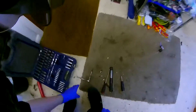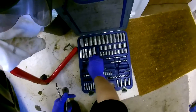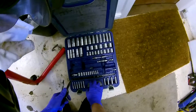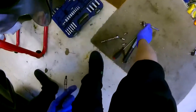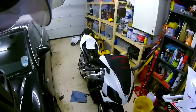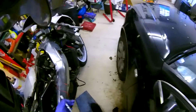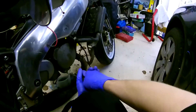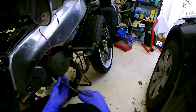All you need now is some tools. You're going to need a 5mm Allen key. You're going to need — I can't remember what size socket it is, I'm going to guess a 19 — and whatever your flywheel extractor requires. First of all, you want to remove the right-hand side fairing. Then you want to remove the flywheel cover. It takes a 5mm Allen key and these bolts are quite long so it takes a bit of time.